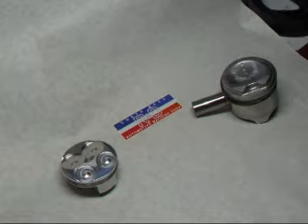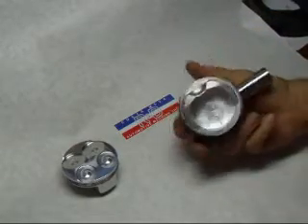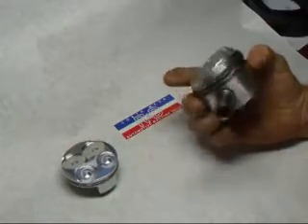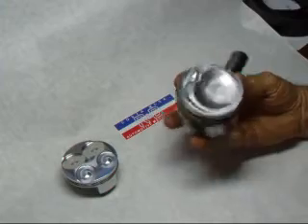Hi, it's John of Costa Mesa R&D. Today we're going to be looking at a couple of pistons we've got here for a Fiat 850. This is a real typical piston that we used to get back in the 60s, 70s, and 80s. This was made by Borgo — it was called their Testa Special, which was their 10 to 1 piston.